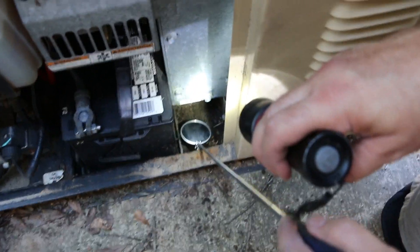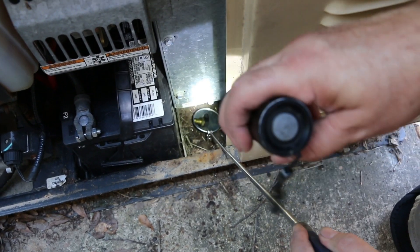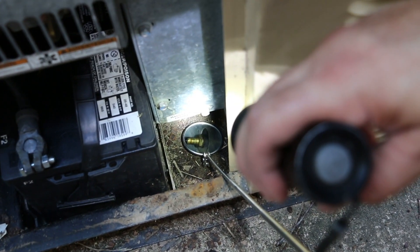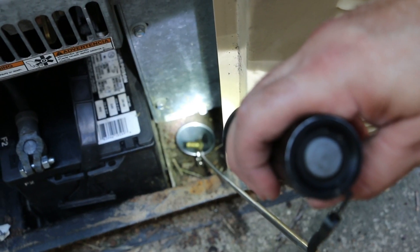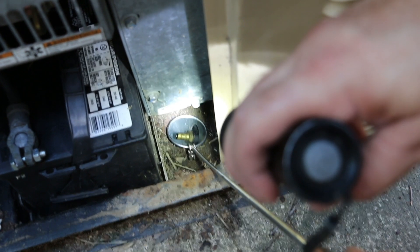You can see the actual radiator drain up underneath the fan guard. That is an 11/16ths nut — you get a wrench on that and loosen it, and then the radiator fluid will pour out. You can see the hose barb there to put the hose on before you do that, so you can drain all of the fluid out.